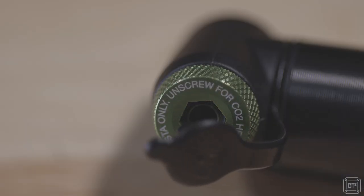In conclusion, at just under £60 this pump is pretty much double the price of the one I'm replacing. You do get a CO2 inflator as part of that, which might cost five or ten pounds separately, but even so it's not a cheap option. The most obvious limitation is the upper pressure limit of about 30 psi. I think this is just a feature of the head design, and the target market is very much mountain bikers for whom 30 psi is probably more than adequate, especially as an out-on-the-trail get-me-home fix. With the Lezyne, whilst it would reach higher pressures, it takes so many strokes I'm not sure I'd have the patience to keep pumping that long.